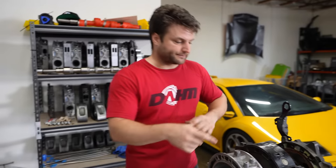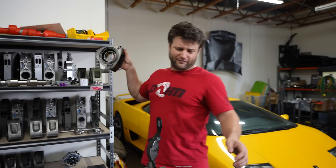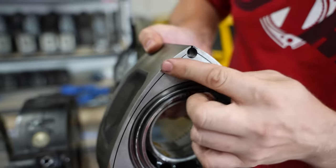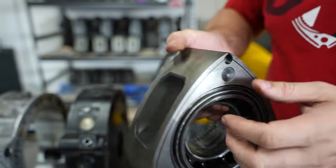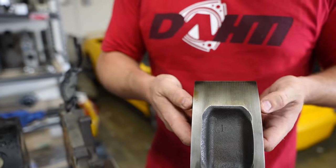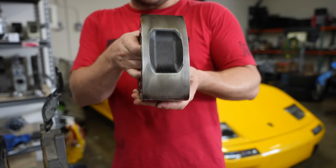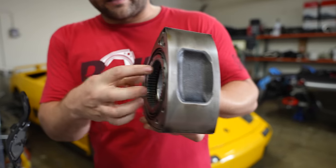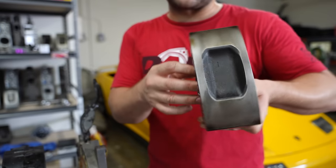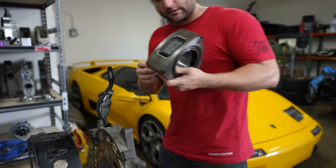The next major thing is clearancing the corners on the rotor — something a lot of people are secretive about for no reason. This is done out in New Zealand and Australia. They put it on a lathe, take this corner and bring it up about five thousandths collectively on both sides. When the rotor is spinning in here and you're making so much power that it wiggles from insane combustion forces, it can actually rub against the side of the engine. That would cause friction and be devastating. Race clearance it in.